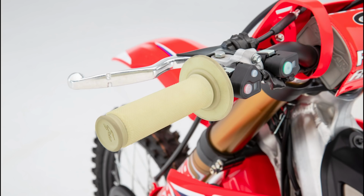It's basically a combination of sensors that senses RPM spikes, whether it's based off a crank-based sensor, whatever. It senses crank-based spikes, and from there, it starts to reduce power based off throttle position. If you're at 50% or less throttle opening and it senses an RPM spike, it starts to back off some of the settings in the mapping to basically back off the power until that RPM spike comes under control. So that's their way of kind of producing traction control on a dirt bike, considering wheel-based sensor systems like you see in cars and road racing don't really translate that well to moto.